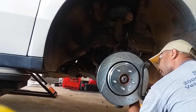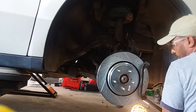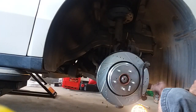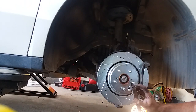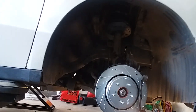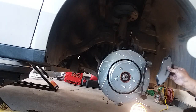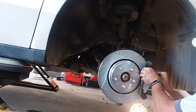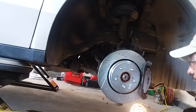I'm going to grease these spots here on both sides and then get the pads in. The one with the wear bar goes in the back wear indicator. Just going to grease these at the ends here. The front pad doesn't mind which orientation it goes in first, but the one in the back — you need to put the top part in first.